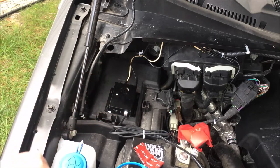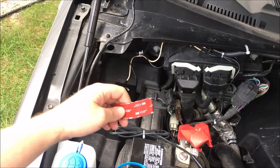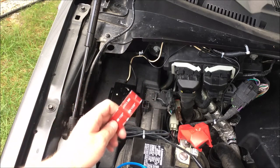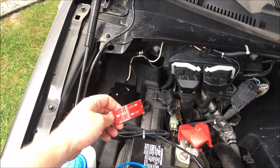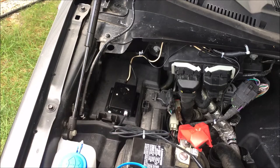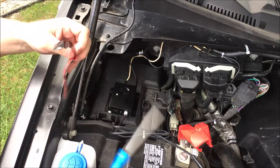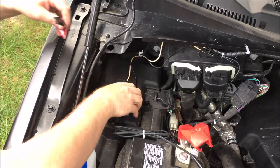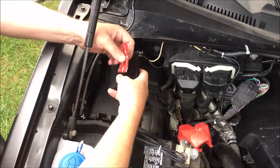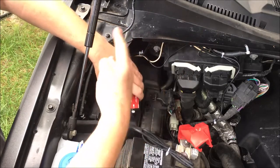For mounting this box, I'm planning to use this 3M — it's called VHB or very high bond tape. You can find it at Grainger and other places. It's a really great tape because it's meant for taking temperature extremes and it's great for automotive purposes. I'm going to take off a little piece and put it on there. This particular grade isn't very thick, so I'm going to make sure I use enough of it. I'll put it on the bottom on both sides, because the case has an indentation on the bottom.